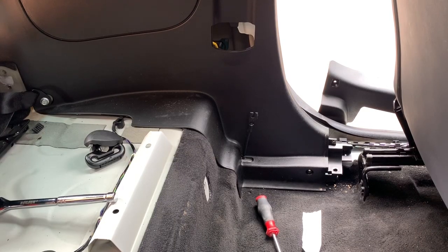The screws are undone and the panel is pulled out and just loose. You can see down there the pre-tensioner - because this pre-tensioner has not actually retracted the cable, it's more difficult to get that through the hole without taking that rear seat belt mount off. But you can do it because you can sort of lift it up out of the way. I'm going to do the pre-tensioner removal in real time and then take the seat belt out as well.